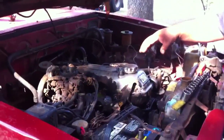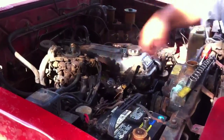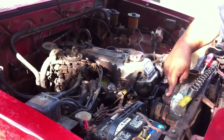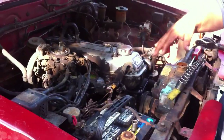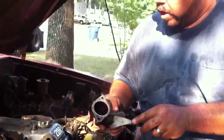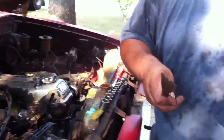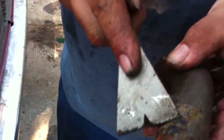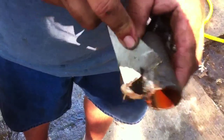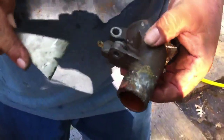Now I'm going to go ahead and change the radiator fluid. Take the air cleaner off so you can get to where the thermostat goes — it's going to be right there, two bolts, and then there's a hose that goes over to it. I took this off first and I'm cleaning it off. You've got to get all the build-up off of here where your gasket goes, both on the housing and the mating surface. A lot of this build-up has to be taken off so it doesn't corrode through the metal, and so it will have a better seal with your new hose.